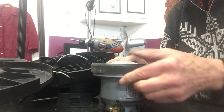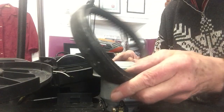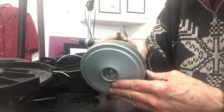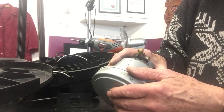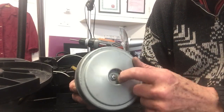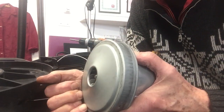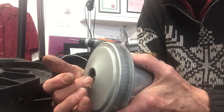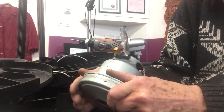If you've got the right motor and the right wattage it'll fit in nicely. We can take that rubber collar off just to look at the motor. Here's your fan section in there — you can't really get into it without destroying the motor. Look inside the fan blades and see if it's blocked. I've seen these blocked solid — it overheats, damages the motor, no suction, and a new motor is required.